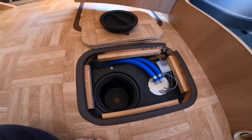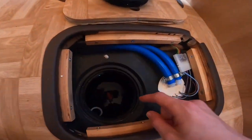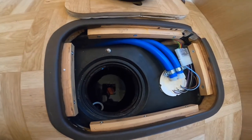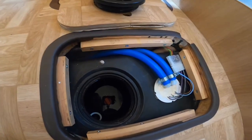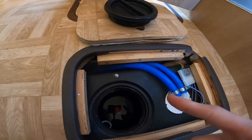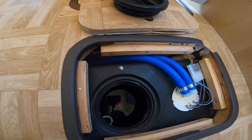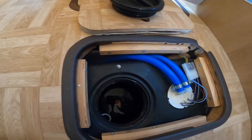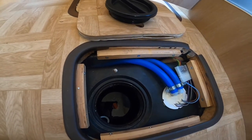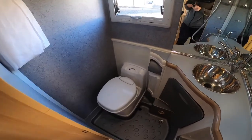To drain your fresh water tank — it's just underneath the hatch beside the bathroom door — you'll see a red plug on a chain. Pull the plug out and it'll drain the fresh water. It's very important to drain this out in the winter as you wouldn't want the water to freeze in the tank, which can split and damage it. Do this if you're not using it for a couple of weeks, or if you've taken on a source of contaminated water.